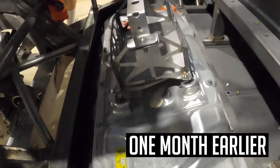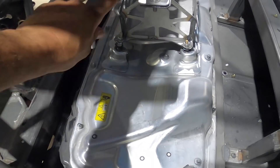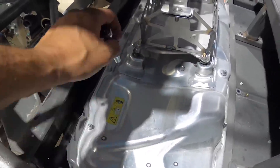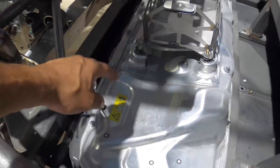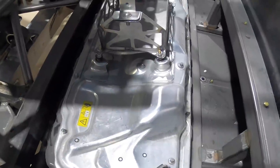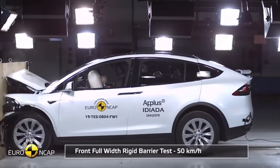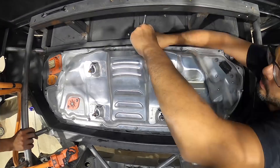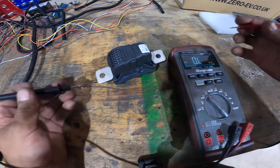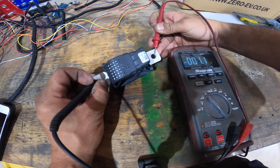What I'm going to be doing is popping off the cover to the battery — a lot of people call it the penthouse. All the high voltage contactors and switching go on inside here. Also inside here is the main high voltage disconnect, which is called a pyrotechnic fuse. We received this battery out of a salvaged vehicle. If the car has been in a collision that triggered the airbags, they would trip the fuse. We don't know the status, so I'm going to have to pull the cover off and physically check it. Quick resistance check with a standard multimeter — we have continuity, so our fuse is good.